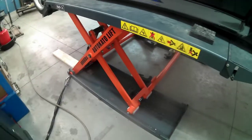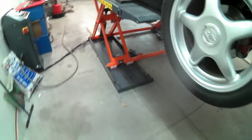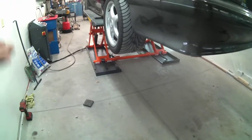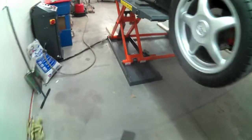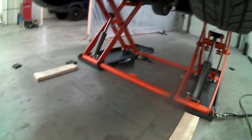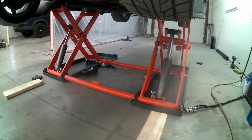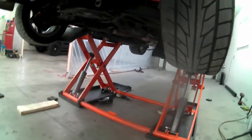With my truck, I turned the timer up so it runs a little longer when it goes down, because the truck is so heavy that when you try to go down it won't go up far enough before it releases the locks. So when I do something lighter like this, it'll deadhead the pump for a second, but it seems alright.